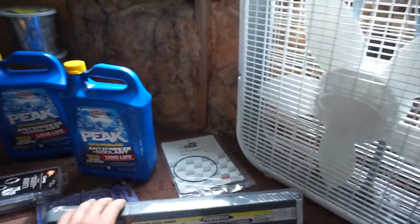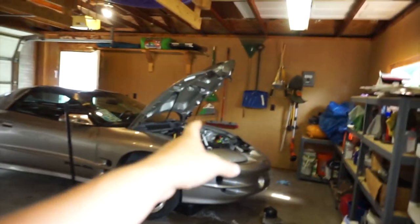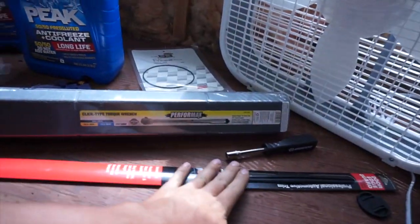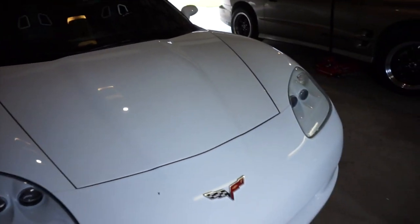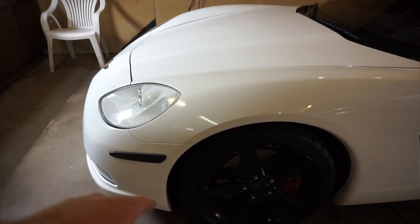Store. I got a little bit of door trim edge for doing the free ram air modification. When you cut up that lower air box, it might look a little rough with a Dremel. So this is just a nice way to trim it out. You can see what I did with it with the C6. When I put in the Z06 front brake ducts, I used that same trim edge when I modified the inner wheel well, and it turned out really good. So I'll drop a link below to that.